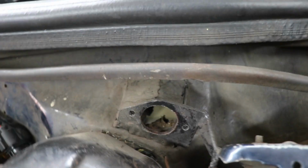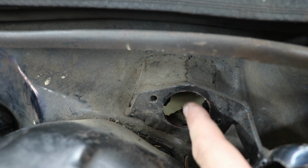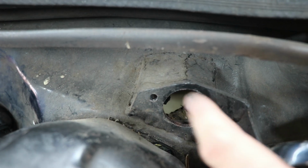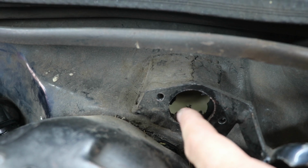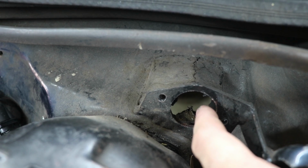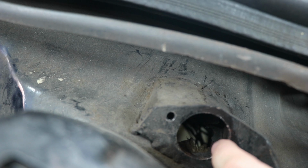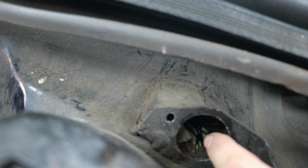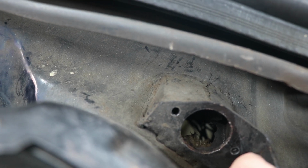The big part of the cable wear is where it ends up is a little off center, so the cable's kind of riding on that thing at an angle. So I'm going to move the quadrant over. I had two washers on that side, so I can pull both washers out. That'll be almost a 1/4 inch, but I might have to hit or cut some more of the sheet metal inside of there out of the way, just to make sure I don't have any problems. I'm kind of hoping I can just hit it with a punch from the bottom side down in the footwell and fold that material up so that it doesn't rub. Might have to cut it out of the way.